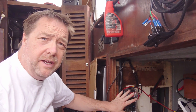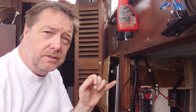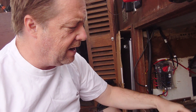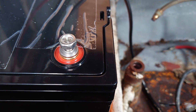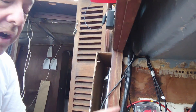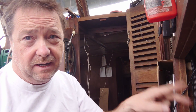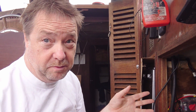A distinct challenge with all this 12V head end wiring is that the actual lug size — the ring size that goes on the terminals — comes in several different sizes. As an example, the battery isolator has 10mm, whereas the bus bar has 8mm. The battery terminals are 8 or possibly 6mm, and the ones on the inverter charger are 6mm. I've got the right cable diameter for the lug, but I don't always have the right terminal. So I had to pause the job and order a whole range of different lug sizes. I've now got a big pile of the different lug types, hopefully with some spares in case I make errors.